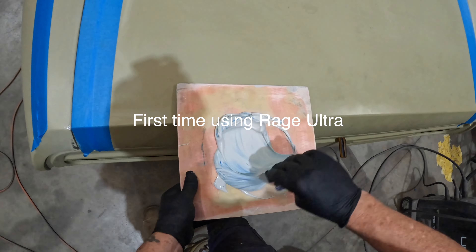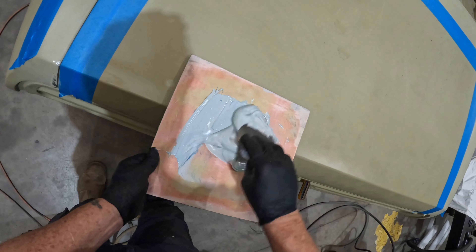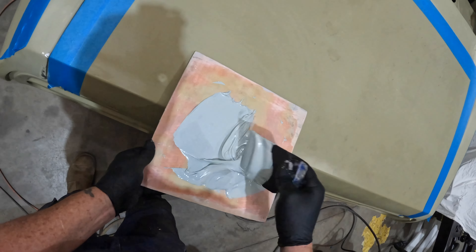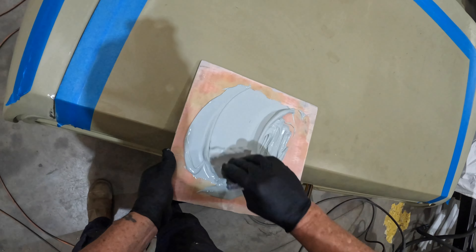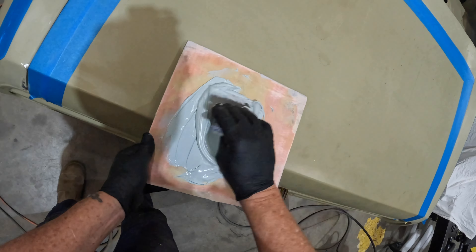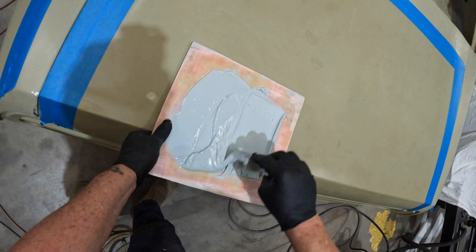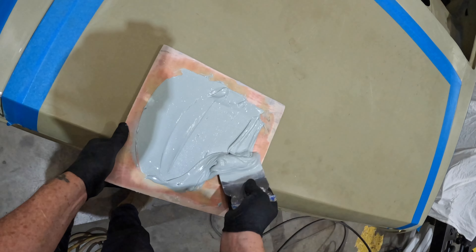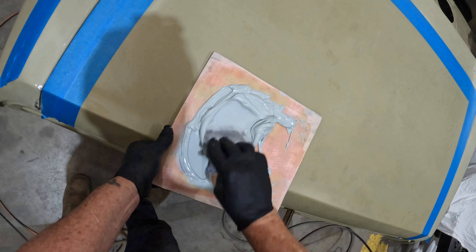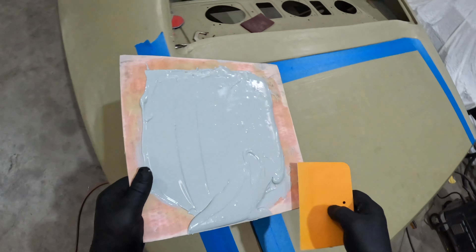Get a flat surface to make it a bit easier. I feel like I've put too much hardener in for some reason, but according to the scales I put in 2% or 50 to 1. Before I used to just guess it, and I noticed that my results would vary a lot. So I figured let's just try measuring it — not everyone does it but a lot do. I found that when I mixed it in a consistent way by measuring, the results of the filler were consistent. The only thing that would vary would be the temperature. I think I've pretty much got that mixed in — I can't see any inconsistency.